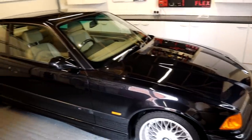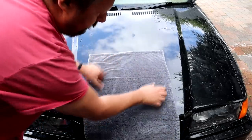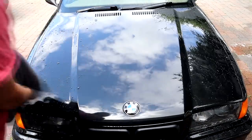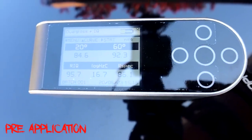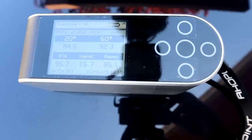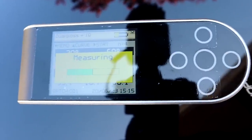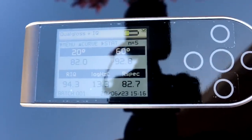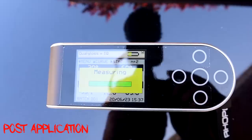As well as adding protection, Touch On adds some shine and gloss — you'll notice it when you dry and buff the car with your microfibre. Normally LSPs give you that final 10%, and I have some figures from the goniophotometer used on our test panel: gloss readings went from around 83.9–84 up to 85.9, with one reading of 88. So it does give you that final bit of gloss — it's not all about protection.